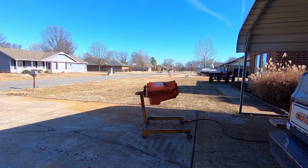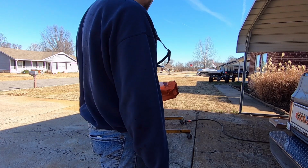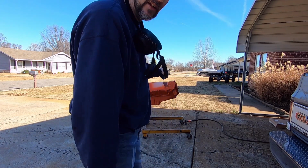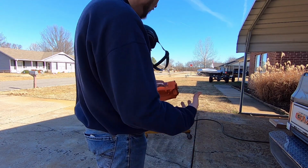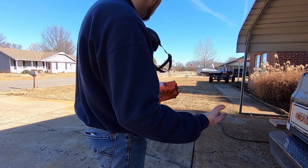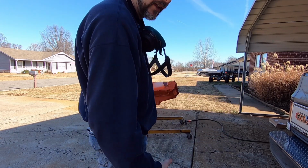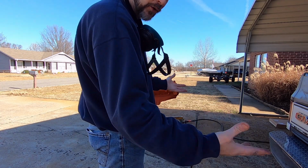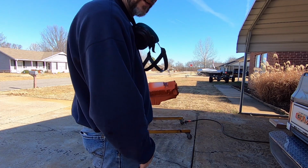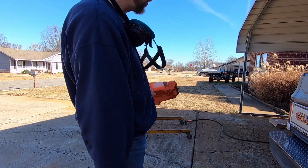All right, so the base is on. It's been setting, I don't know, probably 40 minutes or so. Anyway, it's dry to the touch completely. I went ahead and tack ragged it off again because base coat dries pretty dusty, especially when you're trying to do areas with the fog, which can leave loose overspray on everything. So I always go back and tack rag the whole thing off again, and then it turns your tack rag whatever color you're wiping on, which in my case is orange.